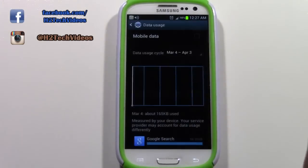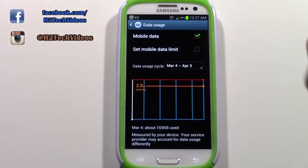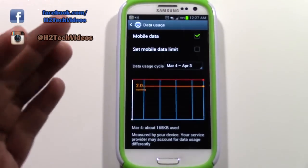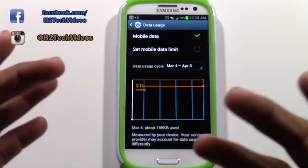It says 'Disable mobile data connection' — tap OK. Your 4G indicator up top will go away. Disable your mobile data, wait a couple of seconds, then check the box again. By doing that, it disconnects your data, turns it off, and when it turns back on it's going to begin searching for the strongest data signal in your area.